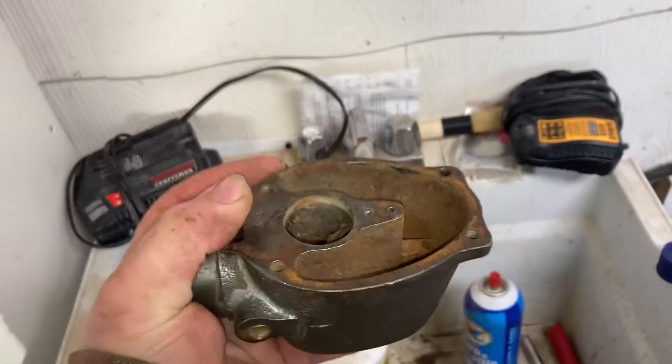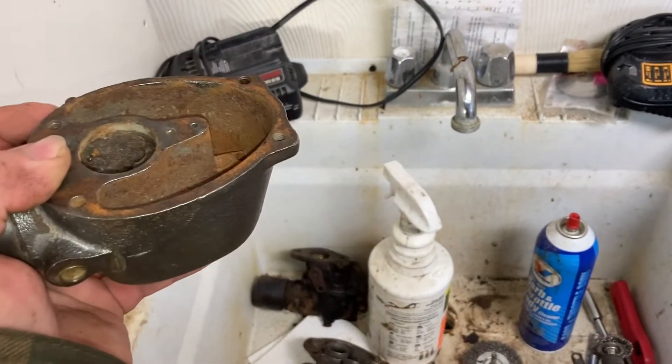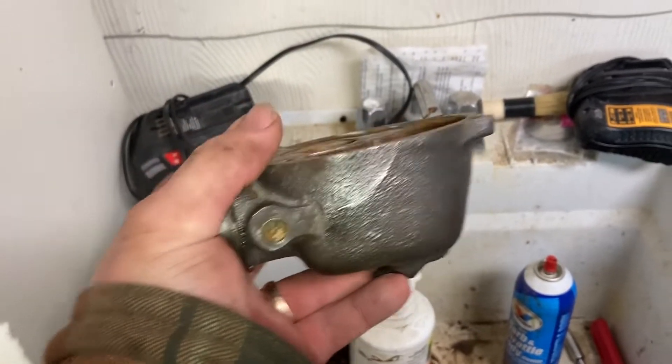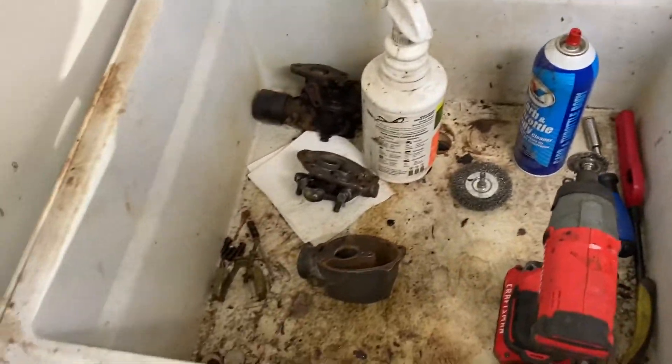This one came out a lot better. I didn't get to replace everything — I took both this bolt and this screw out and cleaned those passages. I didn't take the choke off, but I might — I'd like to replace it in there. It doesn't look that good. It looks a lot better than before though. No more cobwebs. I'm going to end up soaking this as well in some type of degreaser or cleaner and see if that does anything. On to step two.